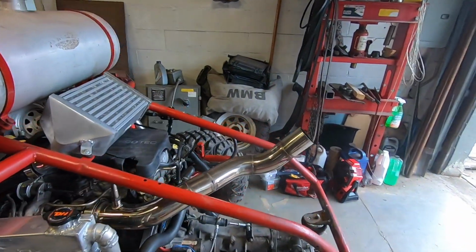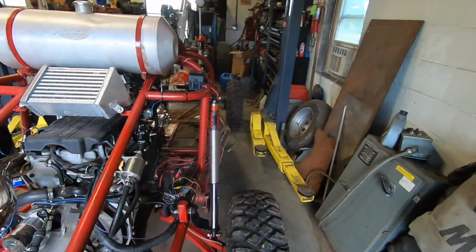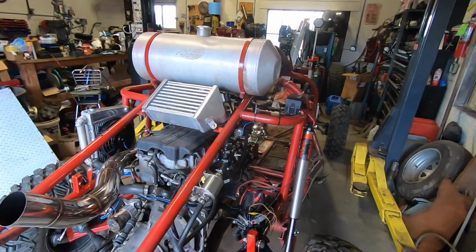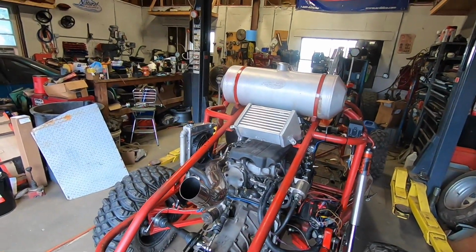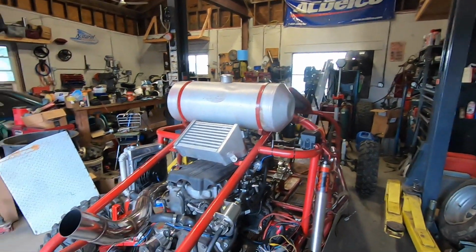We were able to successfully flash a 6-speed manual trans operating system to the E80A ECM. So I didn't even have to go back to the E80, luckily, because I wasn't having any luck with that either. She starts right up now, runs good. So got some work to do, and then we'll make sure she's making the power she needs to.